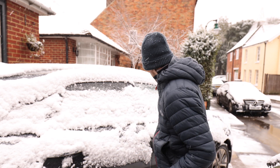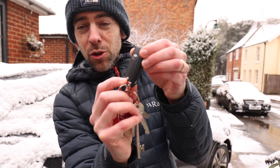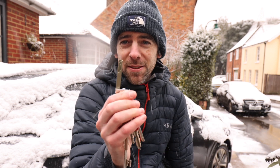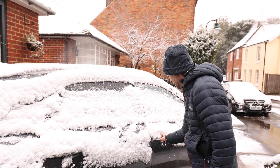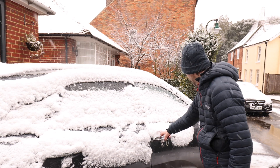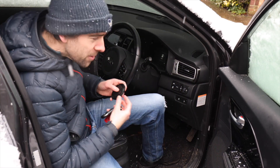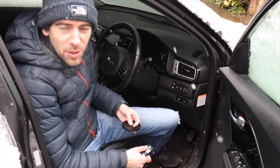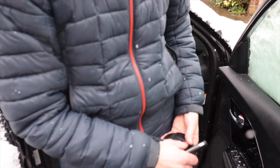I'm going to top up the 12-volt, or effectively jump-start the car. The car keeps locking itself, so I need to open the key fob and get out the normal physical key — press that little button, which is difficult when it's so cold. Now it's time to open the bonnet and jump-start the battery. Before I do that I'll just try to turn it on, and it comes up 'key not detected', which is what it does when the 12-volt is dead.